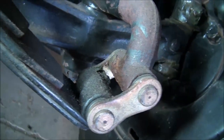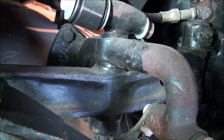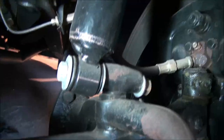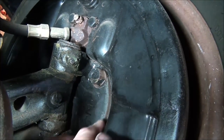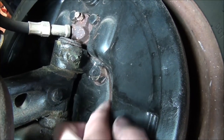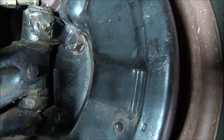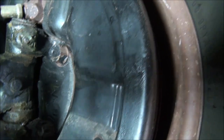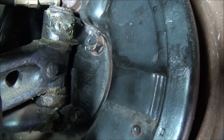And this is the front shackle of the transverse leaf spring, and behind it you can see the I-beam axle. This has been fitted with modern shocks, so there's the lower shock mount. Here you can clearly see why they call them round backs, because the back — where the backing plate mounts to the spindle assembly — is round. The square backs are more of a rectangle and would have a different shape than this. The bolt pattern is different, and the kingpin is just a little bit longer.